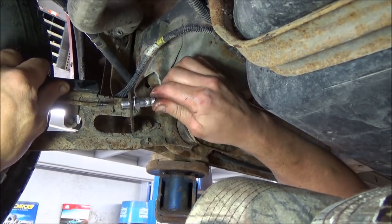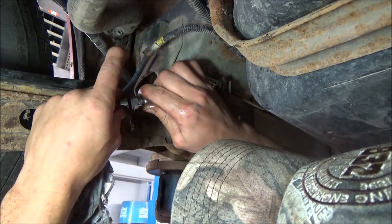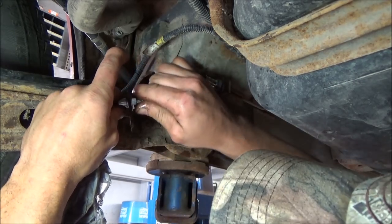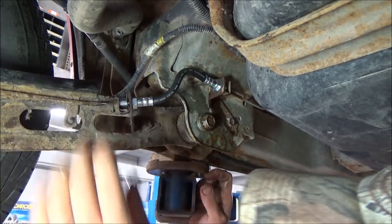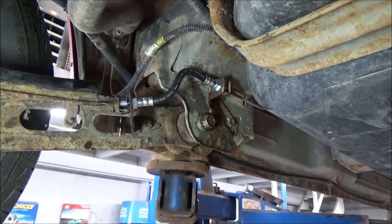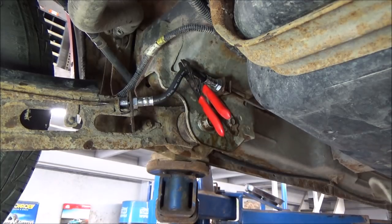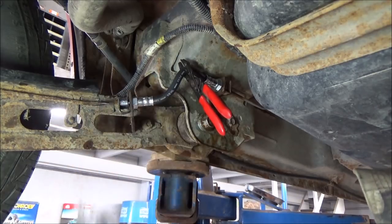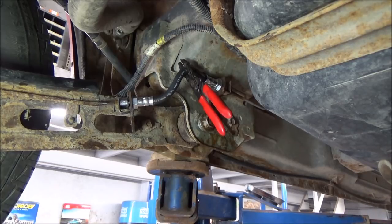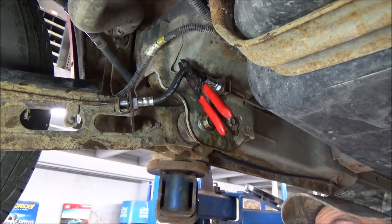We're going to do the same thing on this side. You might have to twist it and rotate a little bit to get it lined up exactly. Once you get that lined up, you can see we've got a good flex in it now — it's not all twisted around there. We'll put our lock on and make our new brake line there. We'll put a pair of hose pinch pliers on there. There's probably going to be a lot of people on YouTube going bananas saying never pinch your brake hose — it's probably true. I've pinched lots of them, hundreds of them, and I've never had a negative repercussion from it. So I'm going to pinch it — not with vice grips or anything, just simply squeeze the hose together slightly to keep it from dripping.